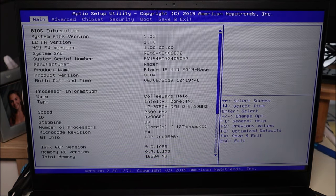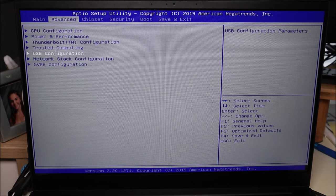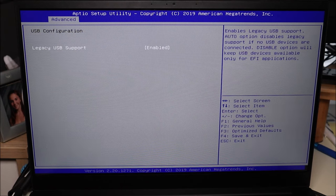Another thing to keep an eye on in BIOS is how you're set to boot up — whether legacy or UEFI. You may have to check your tabs, but for me I'm going to arrow over to 'Advanced' and then arrow down to 'USB Configuration.' I'll hit Enter to open that and there you see 'Legacy USB Support.' If legacy is enabled as mine is, you can try disabling it which will switch it over to UEFI. If you see UEFI is enabled, disable that to switch over to legacy. Basically, whatever you're set at, switch it to the other one, save and exit, and see if your computer boots up.